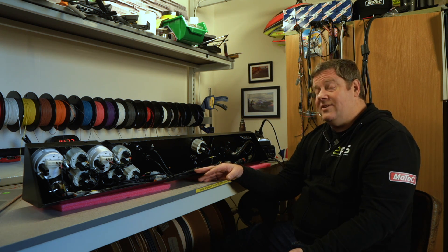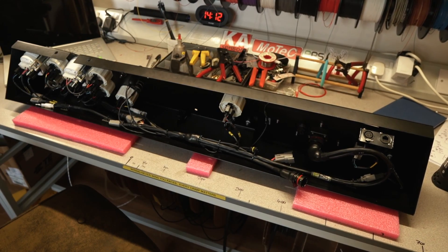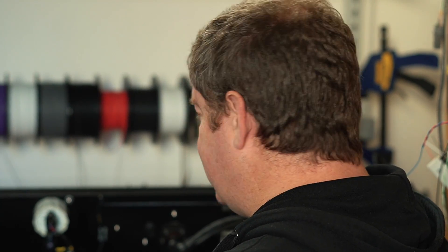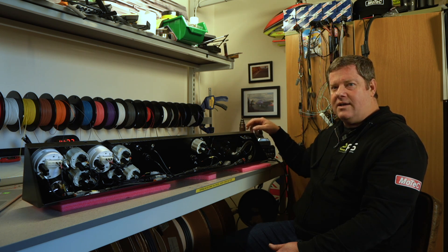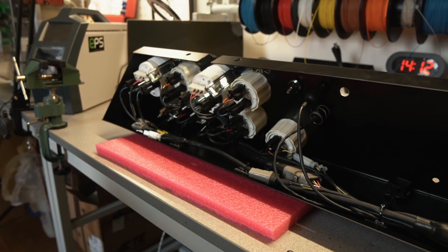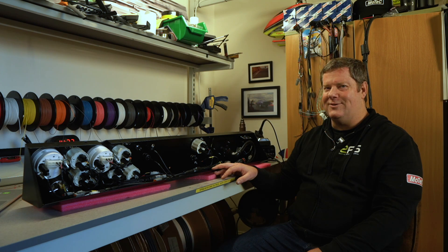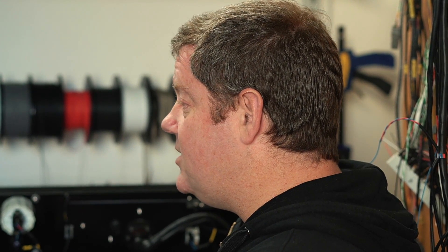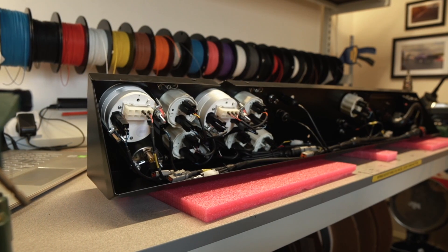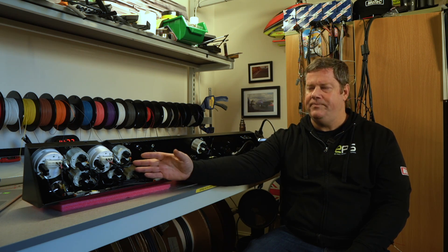How long does it take to get it that neat? This is a week's work just in doing this — by the time you put all the nice shrink boots on, cable tie holders, jewel all your holes, and fit the plugs for the laptop connection so I can just reach under and plug in. Not many people want to show underneath their race car dashboards, but I'm pretty proud of this one. We've even converted all the bulb illumination to LEDs, so it draws less current on the electrical system and we don't need to use the alternator as much.